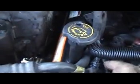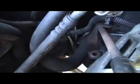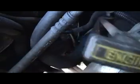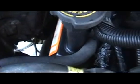Now I've already gone ahead and unbolted it, and I'm just going to tell you why I got it here. Your worst one's going to be this one right here. You got a nut on top of the bolt, so that way it holds your oil dipstick on there. Then there's a bolt underneath. It's 13 millimeter all the way throughout.